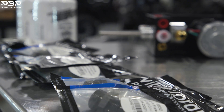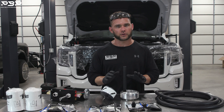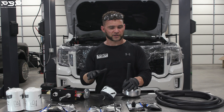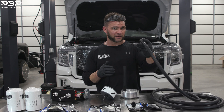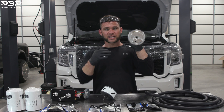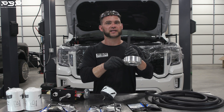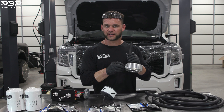Now we've got to retrofit our sump with the appropriate fittings. Keep in mind, we're going to be using half-inch hose. You've got dash 10 on the bottom of your sump — that's 5/8ths. If you want to run 5/8ths hose, use dash 10 on everything across the board. We're going to step down to dash 8; I've made 950 horsepower multiple times with half-inch hose. We're going to take a connector from Vibrant Performance, part number 16832 — it will come with a rubber O-ring. Make sure that's on the fitting and screw it into both sides of your fuel sump.